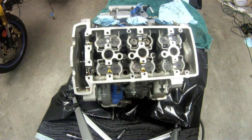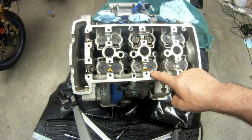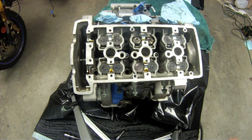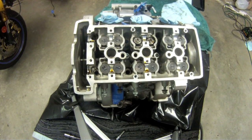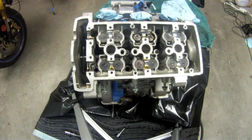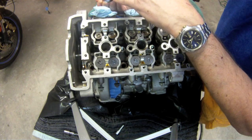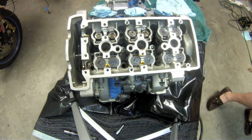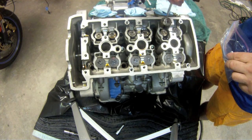You can see the buckets and the shims are all going to probably fall off all of these valves. I've just labeled the valves, and I'm going to use this tape to put each one of these, along with their corresponding shims, in a separate Ziploc bag, so I know how to put them back and have a guide before resetting the valves when I've finished reassembling. Using the magnet to pick them up — the actual shim is held by the magnet — so I'll put that in the bag. Shim's in the bag.